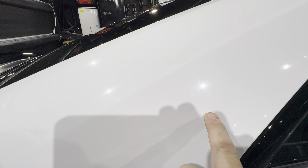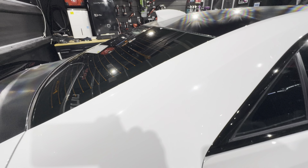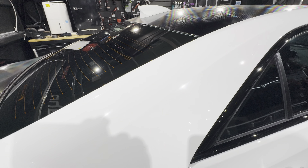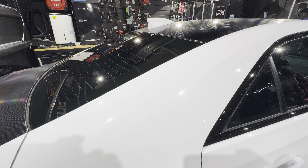You can see this is the only panel of my car purposely not covered by PPF — it's used to show people and do other tests. You can see all those swirls and holograms. This car came like this — when I bought it they had a wrap on it and probably did a really quick, bad polishing job. Now let me turn off the correction lights and turn on the LED lights — you're going to see how even on a white car, I can see those defects under correction lights, but won't see them under the LEDs.